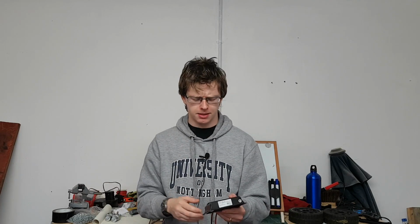So if I take this car out to, say, a radio rally where I might be there for a few days, and I'm maybe running an HF radio off it, I wanted the ability to plug something else into this and it still be able to handle it okay without burning wires or blowing this. So I was planning to get a 40 amp one. I got the 20 amp, but the 20 amp will work fine for a VHF radio, and it may even work fine for an HF radio, provided I'm not running them all at the same time.